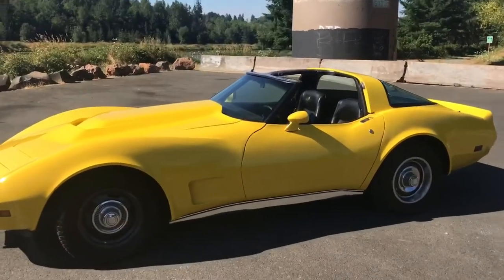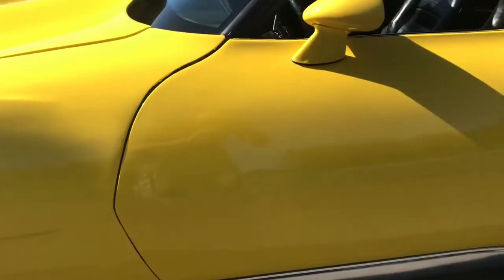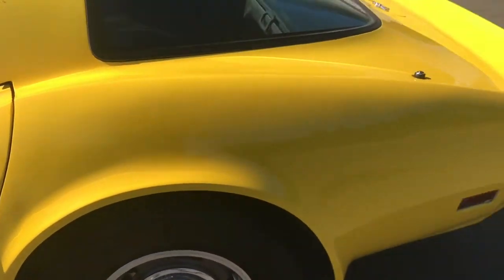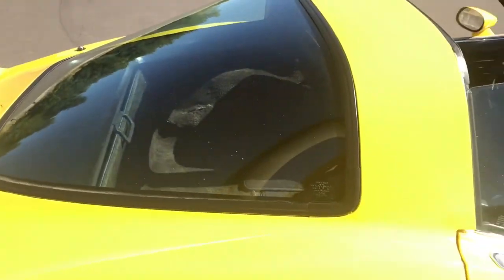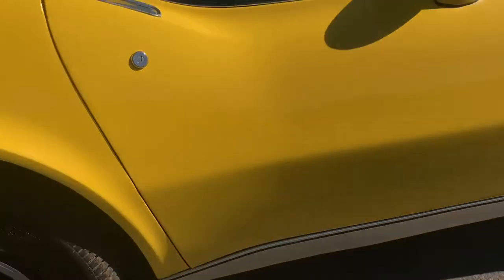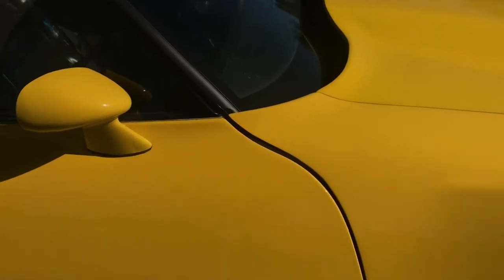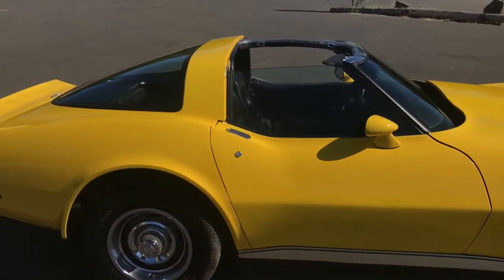See the old walk-around now that it's not in super direct sunlight. The door gaps are okay — not the best. You can tell it's bigger on the top and a little smaller at the bottom. If you look really close, there's a little crack in the paint there — that's for perfectionist types. It could use a new back window; it's got some fogginess and looks like some welding or grinding slag on the side glass. This door gap is much tighter than the other side, bigger here on the top. It's a decent looking, mechanically sound hot rod.